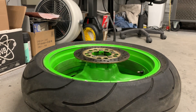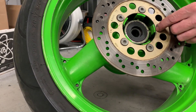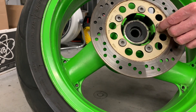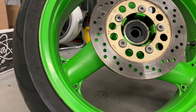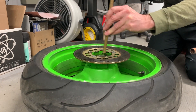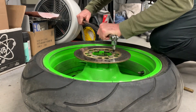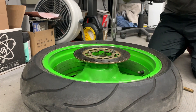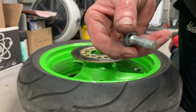I'm going to tackle getting these brake rotors off. These rotor bolts have a very wide head on them, so they get a lot of purchase on the disc. There's usually a lot of Loctite on these things, and when there isn't Loctite, you've obviously got a chance of galvanic corrosion between the steel of the bolt and the aluminum of the wheel. Those five came out really, really easy — absolutely no evidence whatsoever of any Loctite.